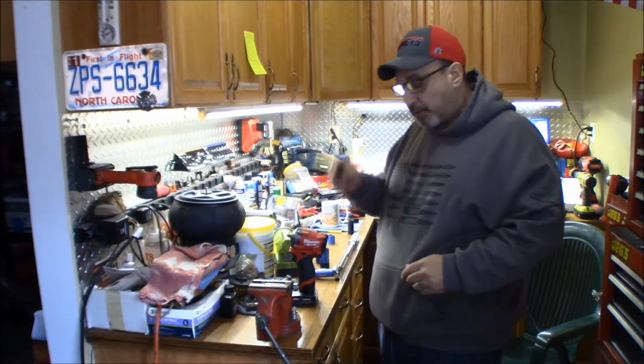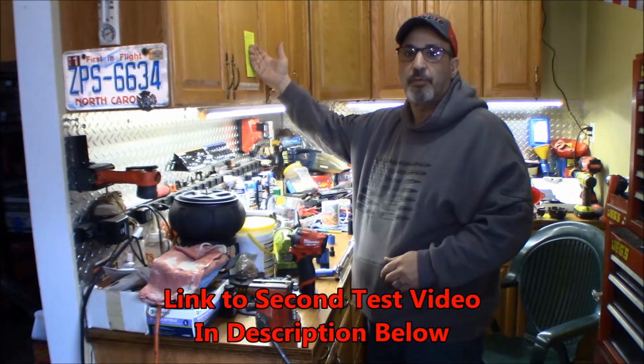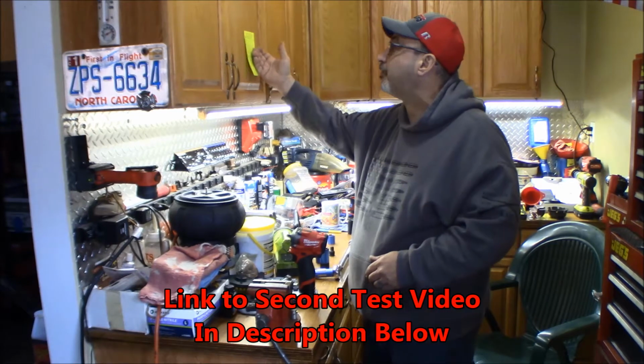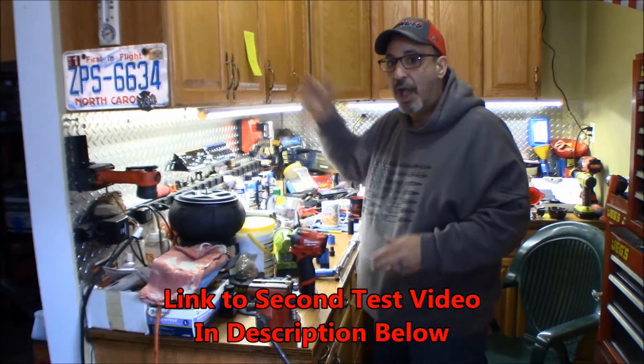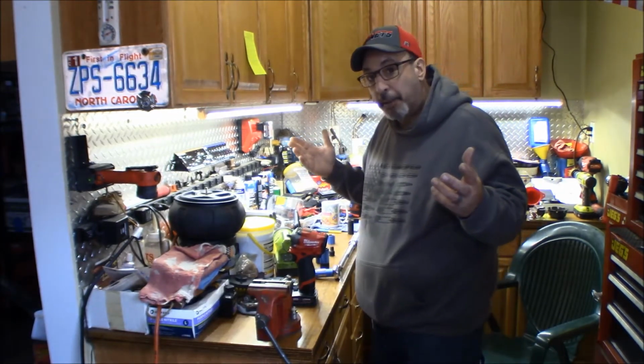Alright, same adapter. And what happened? In mode 1, we almost cut it in half. It went from 45 to 25 foot-pounds. In mode 2, it went from 65 to 45 foot-pounds. And in mode 3, it went from 125 foot-pounds down to 85 foot-pounds. I thought it was going to go the opposite direction. So now we're trying to figure out why.